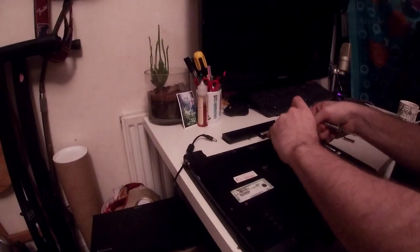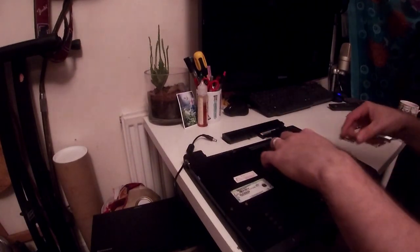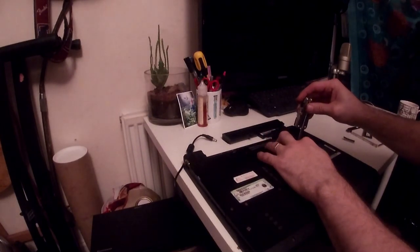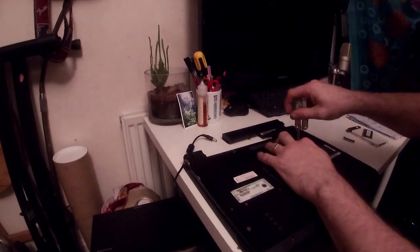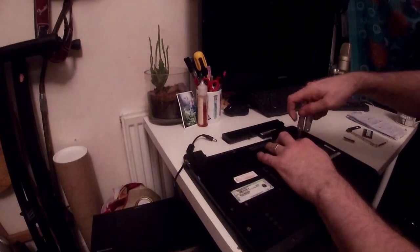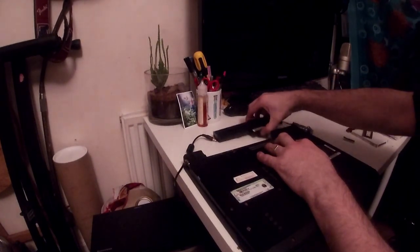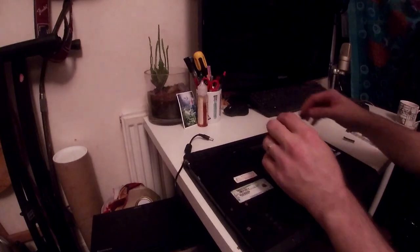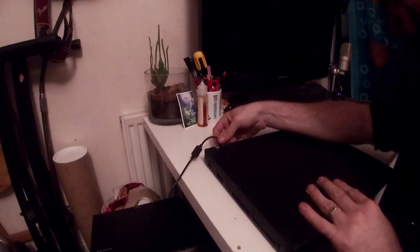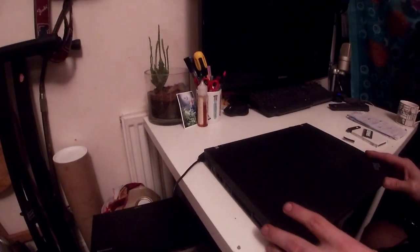And you lift it up, pop out one of those RAM modules, because Windows 98 standard, well, normal Windows 98 can't boot with more than 512 megs, and Windows 98 Second Edition can't boot with more than 1 gig. So we should be groovy now to boot Windows with just 1 gig of RAM. I don't think DOS will have any issues with it, although potentially, but I certainly didn't experience that before, because you boot it through the Windows 98 CD. So be back with the install process.